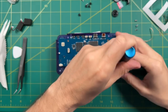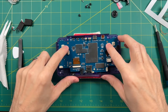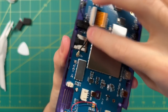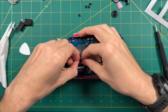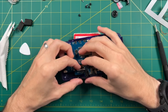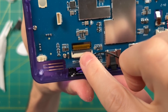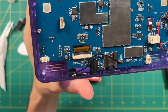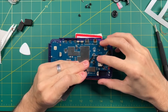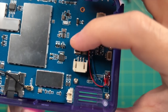Next, put back the five PCB screws — don't worry about the two at the top, those are for the shoulder buttons. Now let's start assembling the other connectors — the Wi-Fi antenna just kind of pops into place. For the ribbon cable, gently bend it around and put it into its slot. Take your time — you really don't want to mess this one up. Just coax it into place and snap it down once it doesn't go any further. You should see a little bit of black coming from the connector. For the analog ribbon cable, use tweezers to push it and your finger to guide it into the slot — this one doesn't go very far in, and you just want to clip it into place.